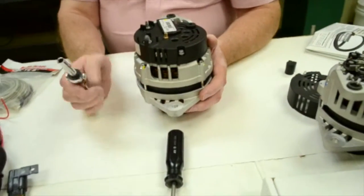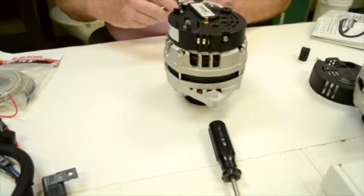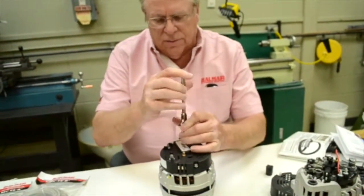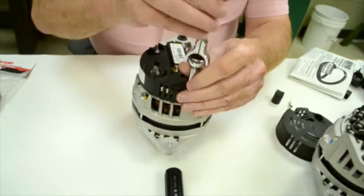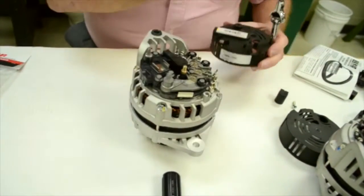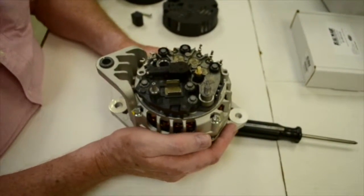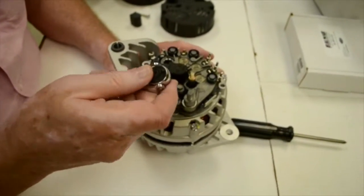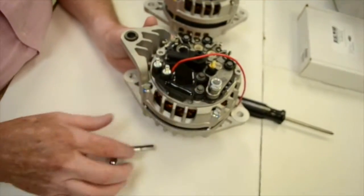As we showed you before, we have two basic tools to do this with. We have the 7mm socket we use to remove the cover. As you remove the cover, there are only two screws doing that. This cover will not be used again because we are supplying you a cover with the kit. This is the alternator once the cover has been removed. As you can see, there are three bolts holding it on, and they are 7mm. So you remove this regulator and install our new regulator.